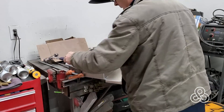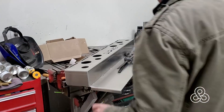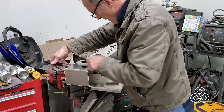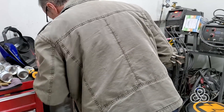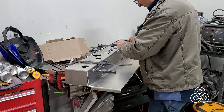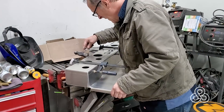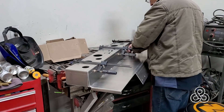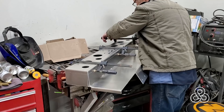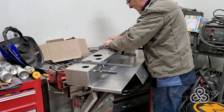Of course there are three bends on the box and slots on two sides with tabs. We're going to put those together — the first ones went in nicely, the second one we're going to have to put a screwdriver and some clamps in there to pull it all together. Get all the slots and tabs lined up, tap them in place. Once we get this whole jig together, we'll go ahead and finish welding up all our slots and tabs.